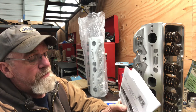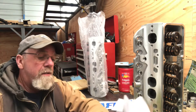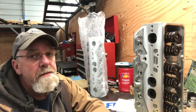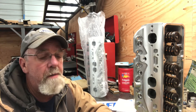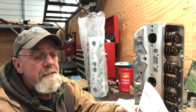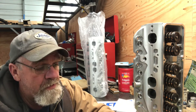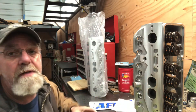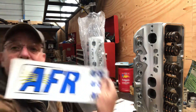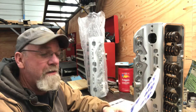The orange stripe springs have a 1.55 outside and 0.800 inside diameter, with a max duration of 260 degrees and max lift of 0.710, rated for 7,200 to 7,400 RPM. I ordered a custom-ground solid roller camshaft, but the cam grinder suggested different valve springs. The cam is going to be a 258/268 split duration, which exceeds the 260-degree max on these springs, and it'll spin to 7,500 RPM — so that has to be dealt with. The heads also come with two AFR stickers.